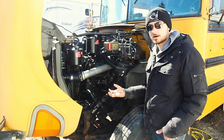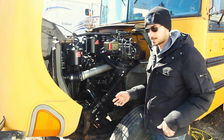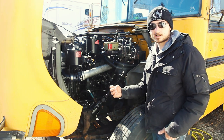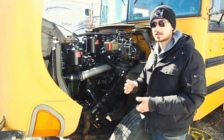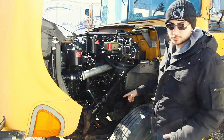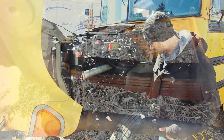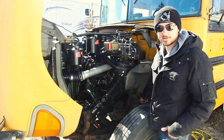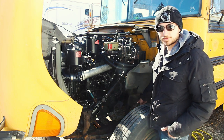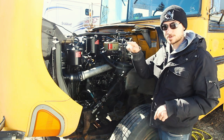With these joints, make sure they're not dried out. It's normal to see a little bit of grease come out and it being a little oily, but what you don't want to see is any cracked gasket and it being very dry — that causes grinding and you'll hear a lot of noise while steering. Also look at the leaf spring, which is the long bar running down here. The most important thing is to check for any cracks.